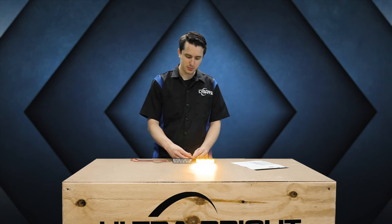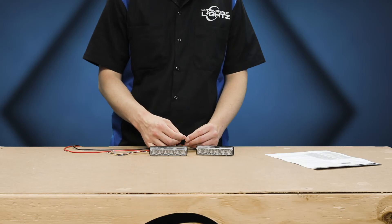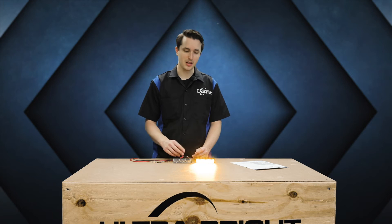Now to sync these up, I'll take the blue wire and hold it down for 5 seconds. If the light turns on, that indicates master, and if the light stays off, that will indicate slave. So I'll set this one to slave and set it to a steady burning pattern. To sync the lights, I'll need to set them to the same flash pattern — the easiest one to indicate is steady burn, so I'm going to use that as my starting point.